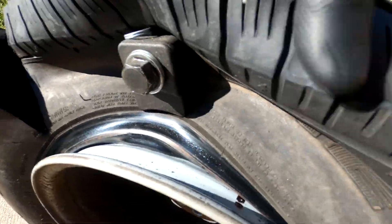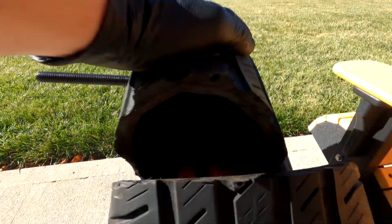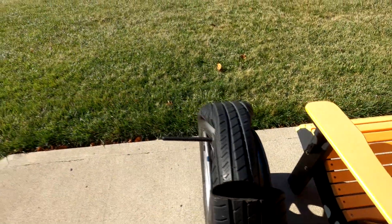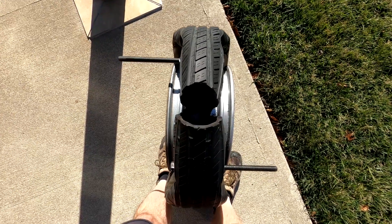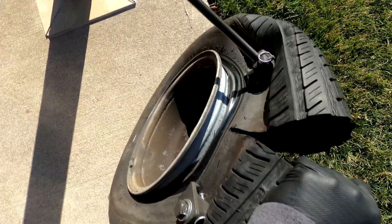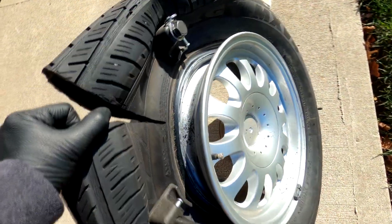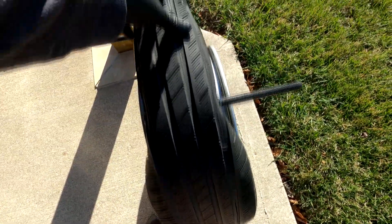As the camera should show, the bead is clearly broken on this side. I cut a hole in the side just to see where I was in terms of the bead coming off on the inside — the camera won't show that. Here is a quick view using two spring compressors. The bead has been broken on both sides. I just need to cut the tire or at least cut the bead and pull the tire off the rim, and this one will be done.